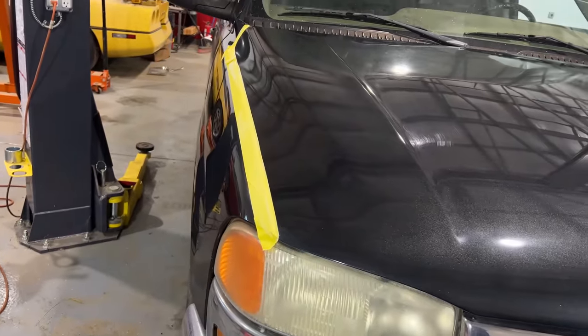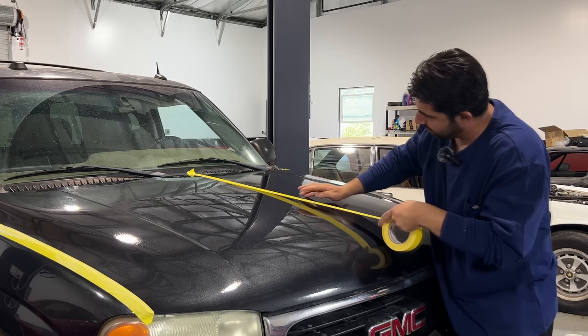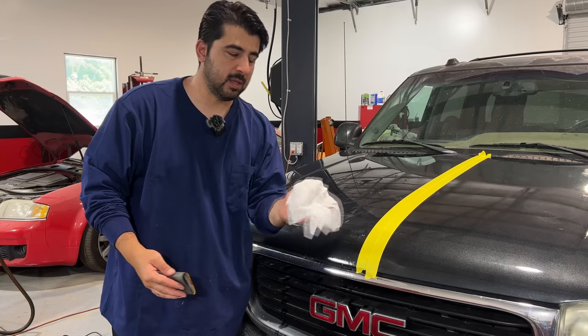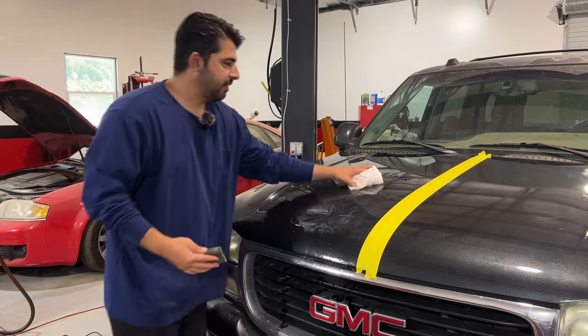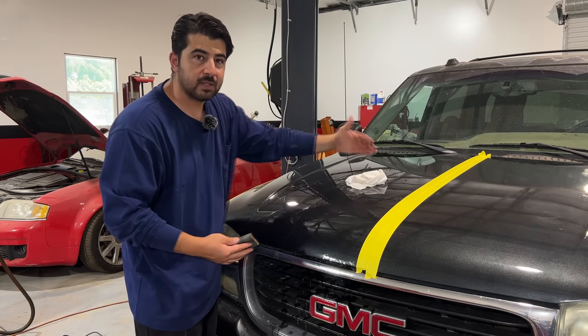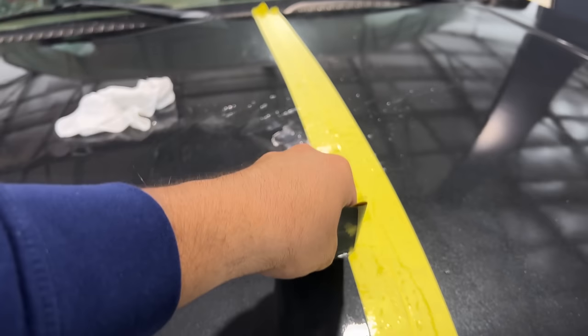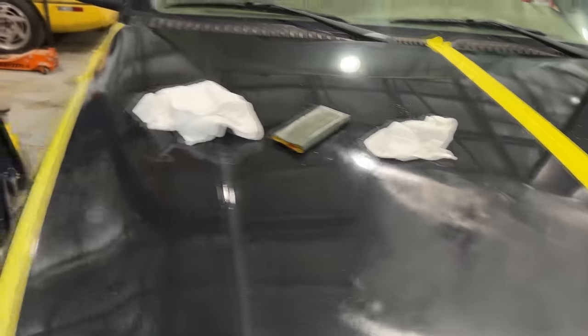Before sanding, make sure you tape the edges of your panel, and also tape the center of the panel for a good before and after shot. Then get a clean bucket of water, wet your panel with a wet microfiber towel or sponge, and start going at it — it's better to split this into sections. You can use the bottom of the soft sanding block to dry off areas you've wet sanded. After about 20-25 seconds on a section, you can see it's fairly well sanded but not completely flat — you can still see a little orange peel. That's pretty much what we want all over this panel.